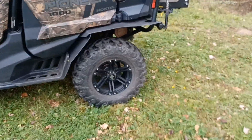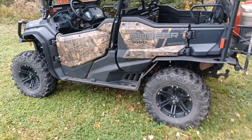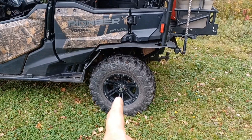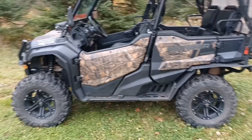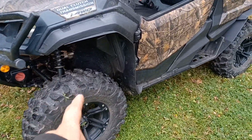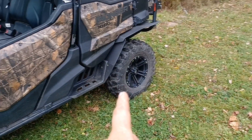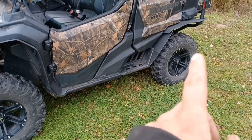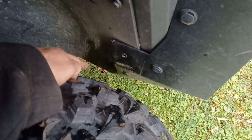Same size all the way around. The original setup I had was a one-inch spacer in the rear and nothing in the front, and it tracked about the same front and back — pretty good. But I had a little bit of rubbing in the front; on hard turns it would rub right in here. So I added two-inch spacers in the back and put the one-inch from the back into the front to keep it equal, but all it did was make it worse — it rubs out here fairly good now.